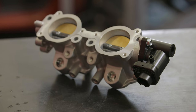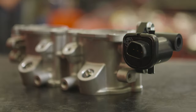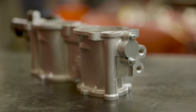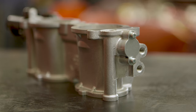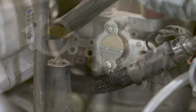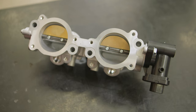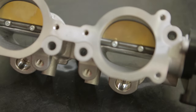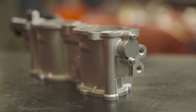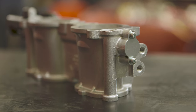The infamous TGVs, or Tumble Generator Valves, found on Subaru EJ platforms are known to develop an annoying leak at a particular location that will first appear as excessive fuel trims and can be confirmed with a pressurized smoke test. The TGVs contain a combo sensor and motor with a shaft that runs through the TGV housing and terminates on the opposite side — that is the specific spot where the leak occurs.